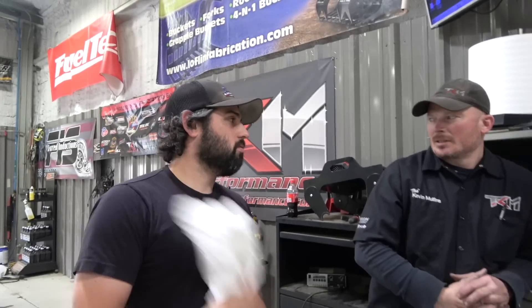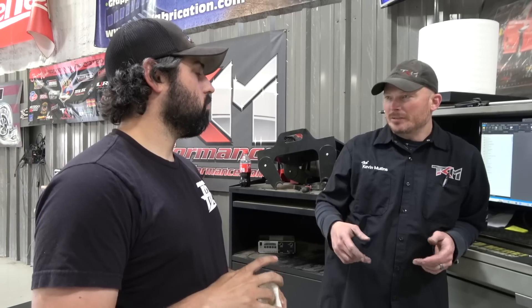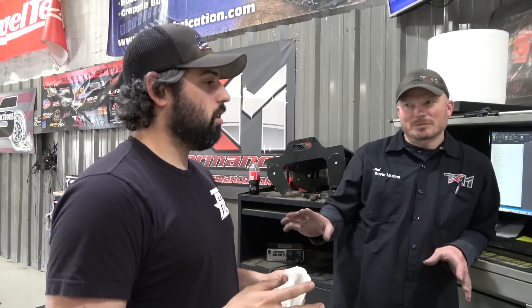Kevin's plan is to come off the brake, do like a 30-60 foot simulated pull, shut it down, and look at the data. Hopefully the converter is actually letting the motor accelerate — this is a looser stator than what was in there previously, so hopefully it's not just blowing through it. We're working with M&M Transmissions; Mark sent us two stators. He said: use this one, shake the car down, go learn it, break it in — and then when you really want to get going, put the tighter stator in and really tighten the converter up. There's no point going out here trying to make 4,500-4,600 horsepower when we're not going to be able to use that power until the car is dialed in.